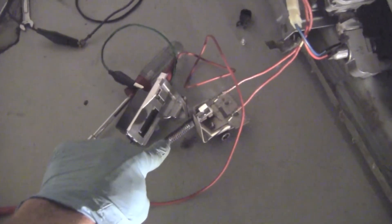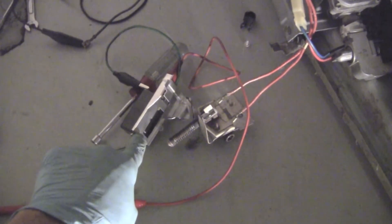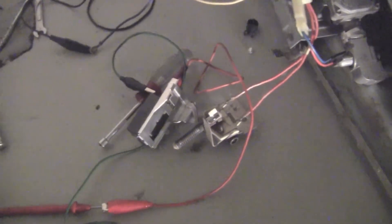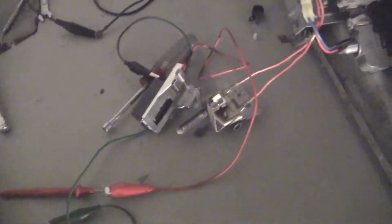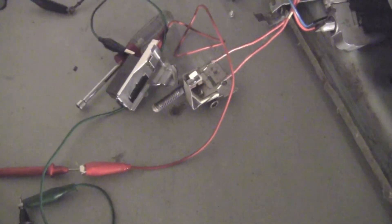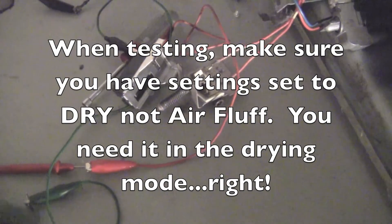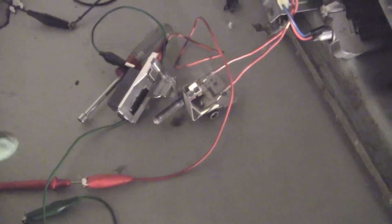The igniter is hooked up. I just pulled everything out and exposed it from the machine, and the gas valve makes contact with this and then the flame starts — hopefully without that noise. When testing, make sure you have the settings on the dryer not on the air fluff setting, because you want the igniter to come on. That's real important — up where the big dial is.